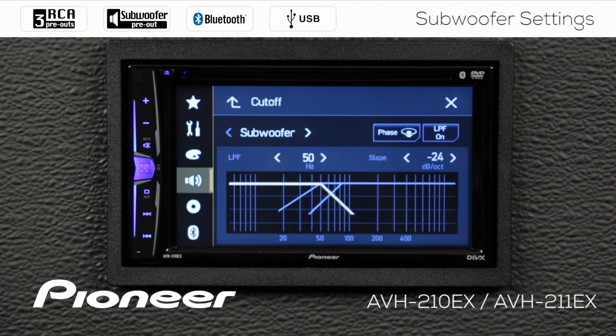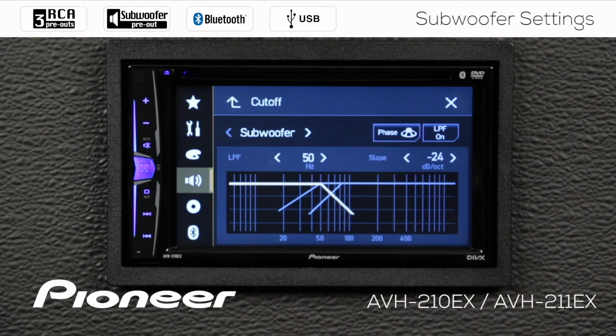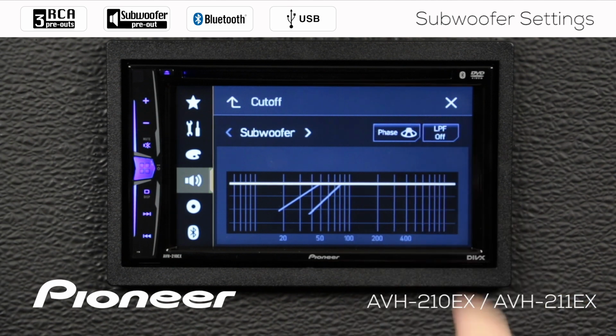Next up is the phase control, and right now we are in the normal phase. We can also choose to switch that to reverse phase. It's very important to try the phase control in your particular vehicle. You may find that the reverse phase or the normal phase works significantly better than the other one. Try them both in your vehicle. Choose the one that works best for you. And finally, over here is our LPF, or low pass filter. That's the crossover itself. We can choose to switch the low pass filter on or off right here.